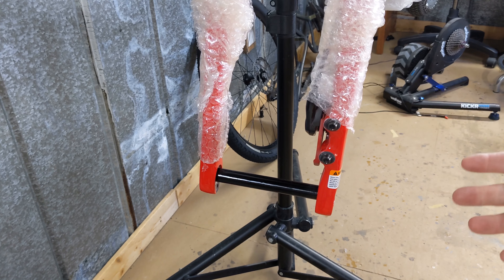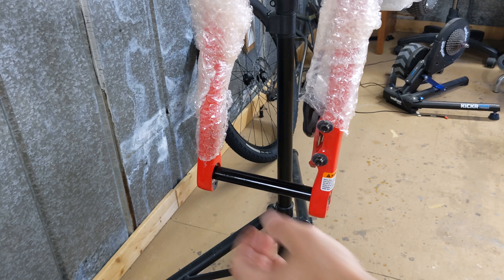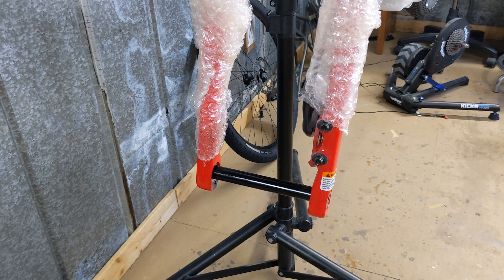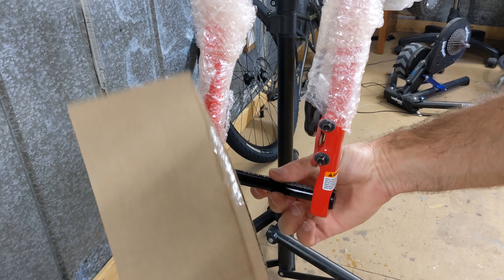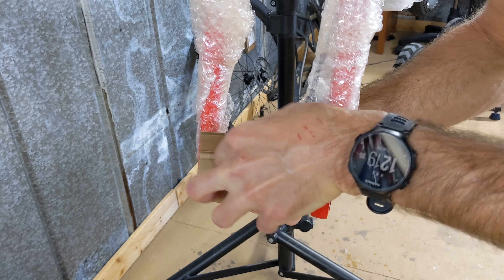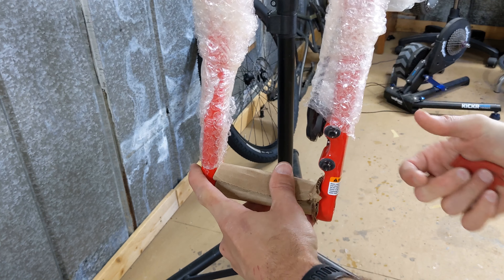This is the front axle. When bike companies ship bikes, they'll have something inside to support it — as I push on it right here, you can see it kind of going in and pinching together. If something landed on the box, it could damage your fork. So you want some kind of support inside to keep that from collapsing. If you have a piece of PVC pipe you could put in there, that works. What I found is you can get a piece of cardboard, measure it to about the same width, wrap it around the fork legs, and tape it. That will provide support and hopefully prevent fork damage.